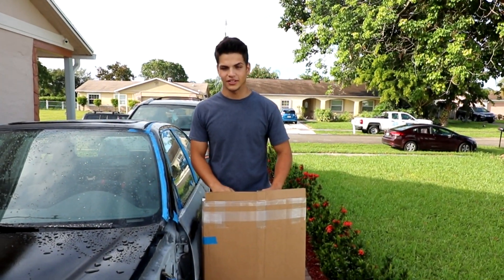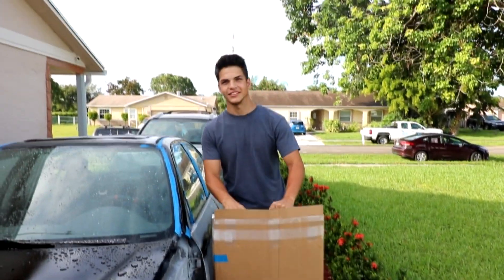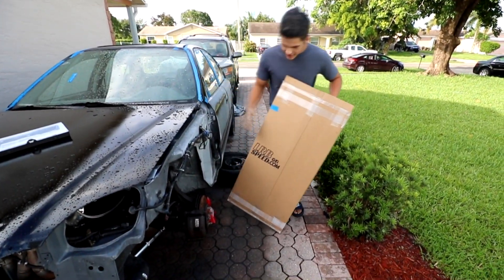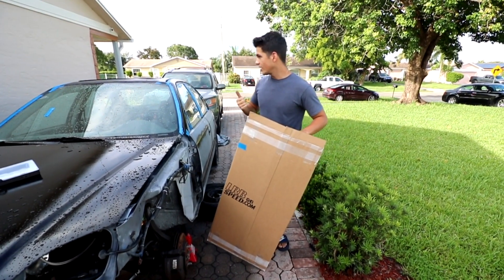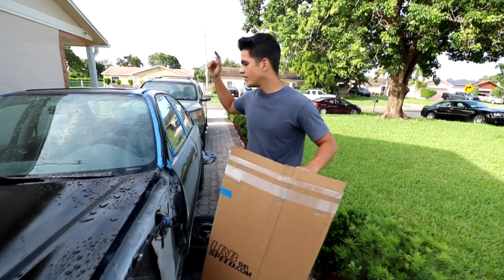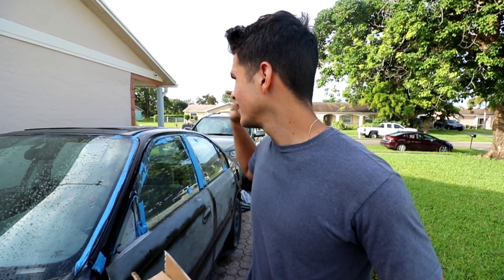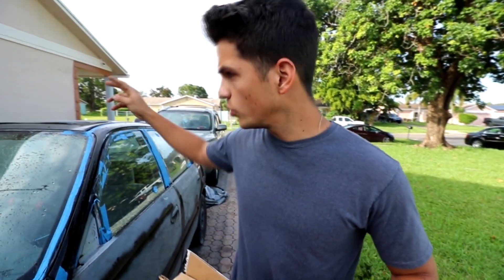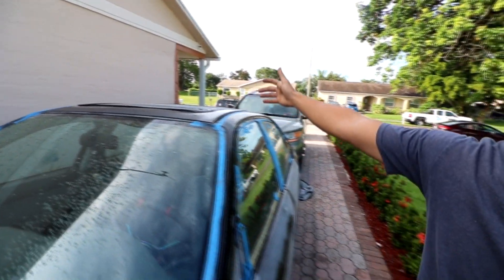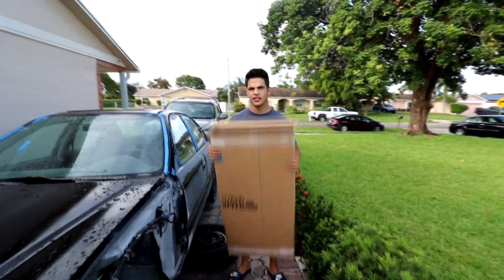Hello and welcome back to D&A's Garage. Today we're gonna be doing a sunroof delete install on the rust bucket. We're deleting the sunroof — so EcoBoost, you're next. This is pretty simple: they give you the rivets, the drill bits, and it's pretty much a two-inch overlay of the actual hole in the body. Just seal it up with silicone, drill the holes, pop the rivets, call it a day.